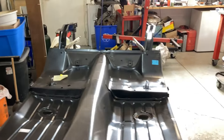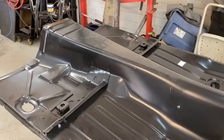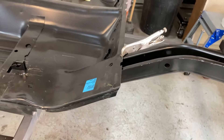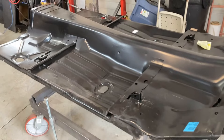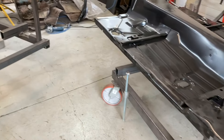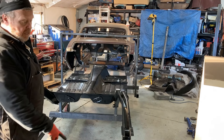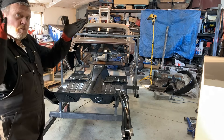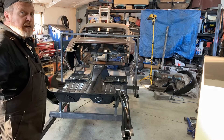The bolt holes are snug against the frame rails, so I know the floor is 90 percent in the right location. What's going to give me 100 percent surety? The trunk floor goes on first — the full floor fits over top of it, but I don't want to fight the trunk floor to properly line up the full floor. So I'm starting from the full floor back, and this is where the beauty of my bastardized frame jig reveals itself. The only height difference between the floor jig and the car jig is larger wheels on the floor portion, just enough differential to get the front of the floor up above the rockers, which slope in — so it doesn't have to get up that high before it's into that relief and rolls right in.